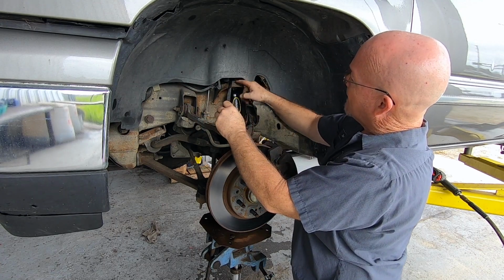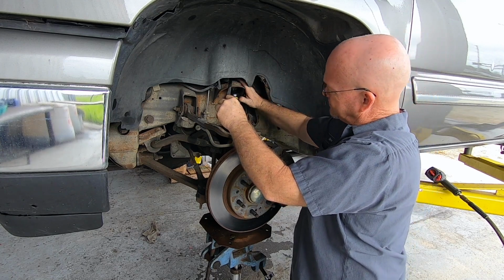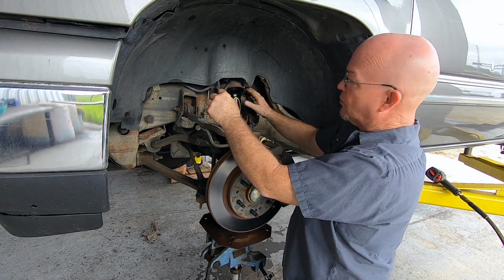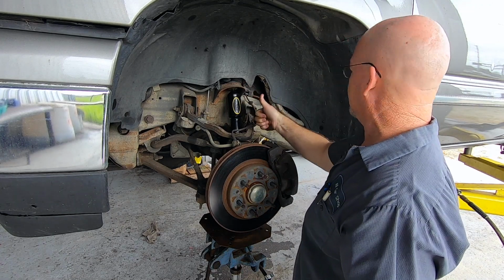All the load is on the top, so I tighten the threads. I'll be able to see quite a few threads on there, and it compresses that because this is loaded. But eventually the weight's going to be sitting underneath it and compress the lower version. I've got about a half inch of threads peeking up, so I know I'm golden.